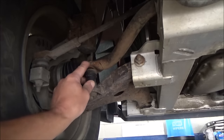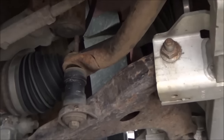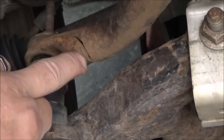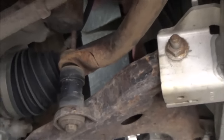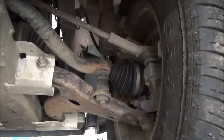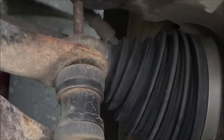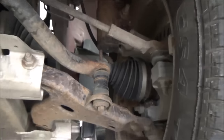Right here on the driver's side it's really common to see these sway bars break. I think it's because they're hollow — I don't know if they get water in them and rust from the inside out — but it's not uncommon to see them come in cracked right in half with the ends busted off. You can see on the passenger side that's still in pretty good shape, no cracks or splits, but one side's broke so we've got to change the whole thing.